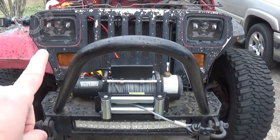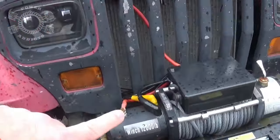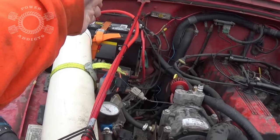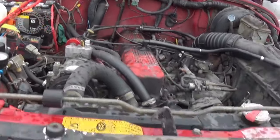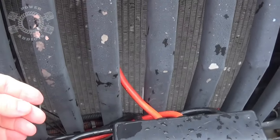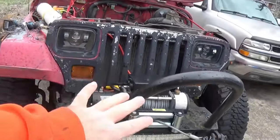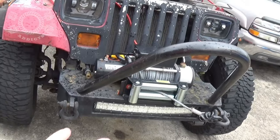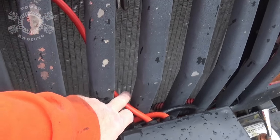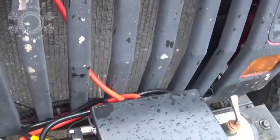Got my winch installed and functional, but there's one little caveat — what do you do for safety? You've got your wires going to the winch, some big ones going through the grill right here, coming around, going back to the battery. I don't have it connected at the moment because I connect the winch when I need it. But here's the problem: you've got this big huge cable. Oftentimes people want to put in some kind of circuit breaker. In the event you're cruising down the road and a deer comes through and hits your grill, this wire could cut against your grill and get into it — now you've got a direct short from this big cable to your battery. That's not good.